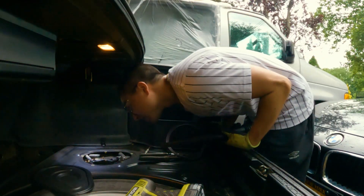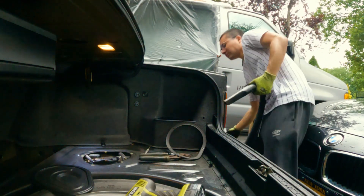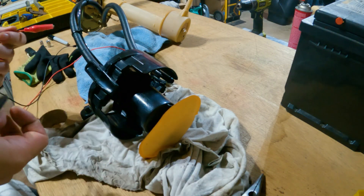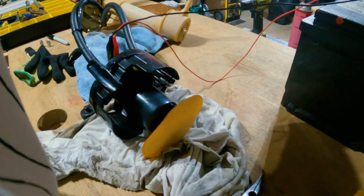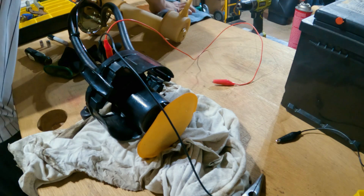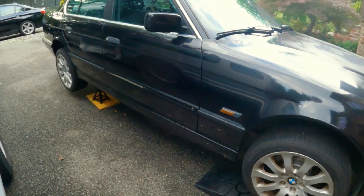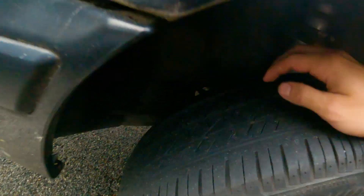I'm gonna run this back inside real quick — I don't want any rust flakes falling in. There's some crud under the fuel filter. Now we are gonna test if the fuel pump works. Okay — well, we know that it works, which is actually odd. It's another day — we got the car on jacks and ramps. I'm probably gonna have to take this wheel out since the fuel lines come out right behind here.